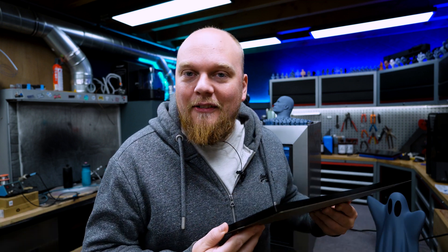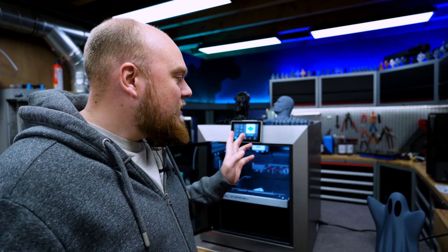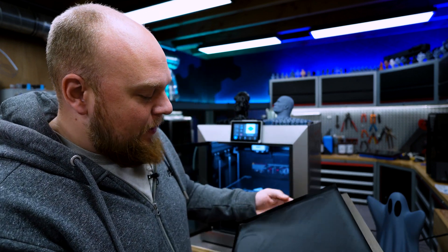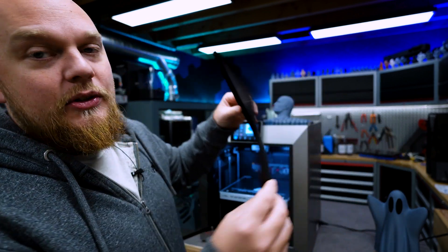I'm going to show you a little demonstration of how that could work. I think they did it on purpose that the print head can hit the frame to make a filament cut, so you don't have to — really neat. They are not confirming anything, so it will still have to be seen. You can hear right now the first layer just peeling off the build plate. It will be interesting to see if they are going to use the feature, or if it's really more of a design flaw and the filament cutter just gets in the way. But they were smart enough that the filament cutter is sticking out, hitting that bump in the corner — they were thinking forward for the AMS. Now the first layer is releasing and the build plate is completely cooling off.